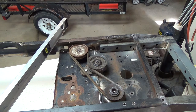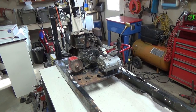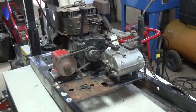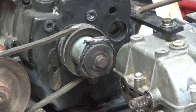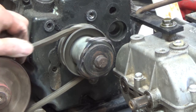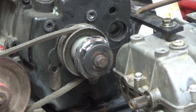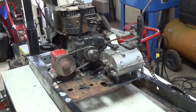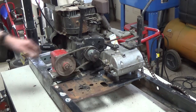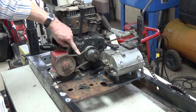I'll flip it over and show you what's going on on top. Not much has changed up here once it's all together, but everything is bolted down now. I'm going to have to make sure I don't forget to finish trimming this pulley off here, because when it turns it's sometimes very, very close to the housing. I've got only two bolts in the motor just getting it located where it's going to go. The motor is going to turn counterclockwise looking at it from this side, so it'll be pulling tight here — I will have to put an idler pulley here.